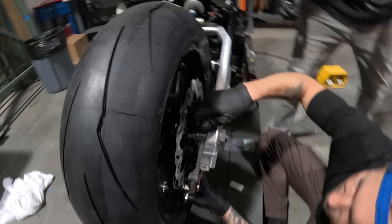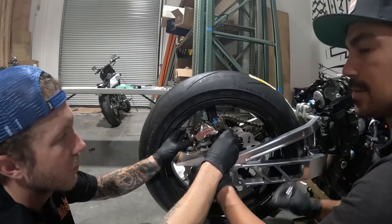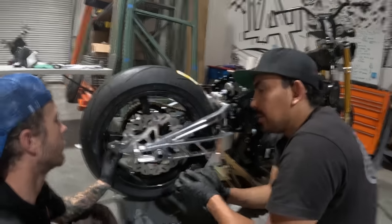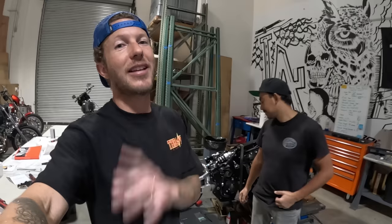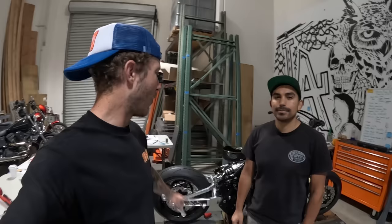Already whacked the wheel. It's not centered at all — we're gonna take some off of this and add one here. We need to center the caliper with the rotor and adjust the height. We'll trim the inside spacer to let it go in more and put a third one on the outside. To be completely honest, I thought we'd be here before lunch — swing arm easy, front end easy, I've put the front end on 10 times — but you have a lot more work than I anticipated. Got all week, it's Monday. Tune in tomorrow at 4 p.m. PST!